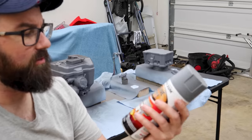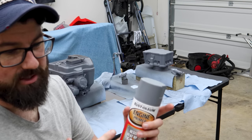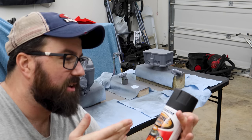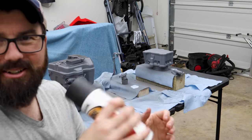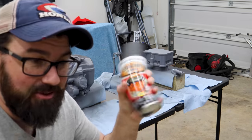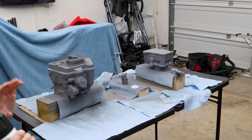I've been doing these coats about 25 minutes or so apart, that way they have a chance of drying up enough that they're not running anymore, but still enough that the next coat will kind of stick to it. It's supposed to be a low gloss black. I think because of the enamel it'll never be a completely straight satin black. Light, light coats. If this applies the same as the primer has, we're going to be in good shape, because the primer has really done a great job of smoothing out, covering everything smoothly and evenly. It looks great.